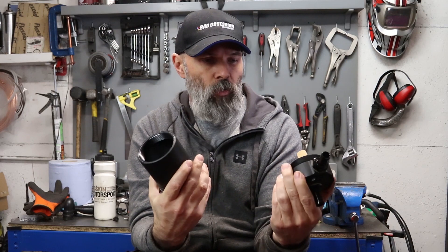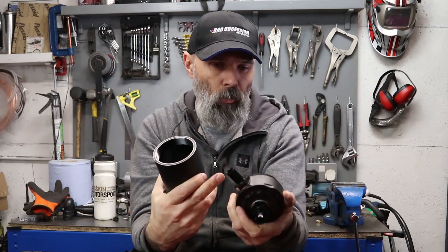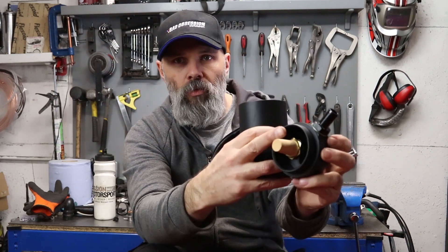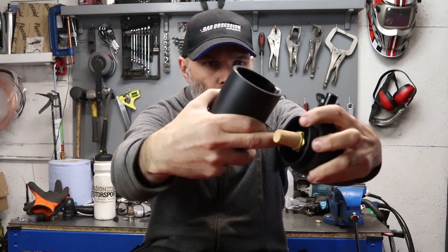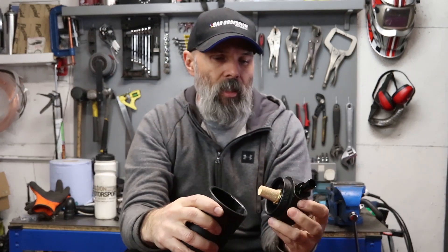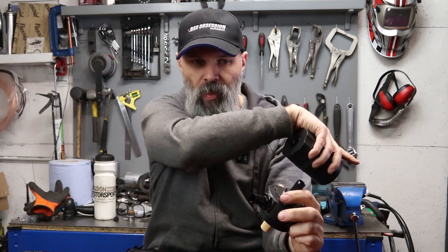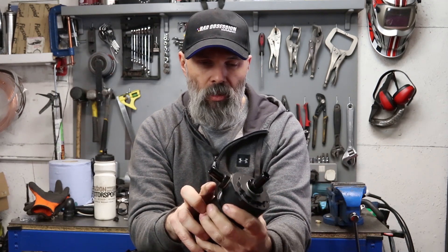Just while I've got this out — basically turning it around, there are just some bolts that go in the top. It's quite clever: you've got the air coming in through there, this special thing is a disruptor designed to send the air down. You can see there's the baffle plate in the bottom there and then there's a drain underneath. The air gets sucked up through here, basically drawn by the pressure going through into the engine or into the turbo. That's essentially how it all fits together.